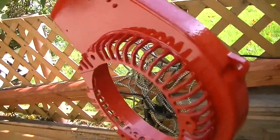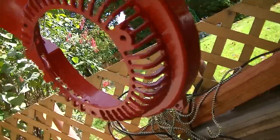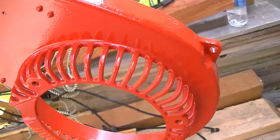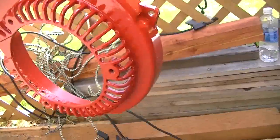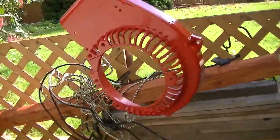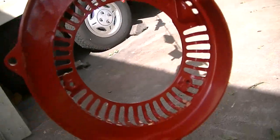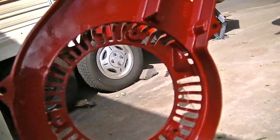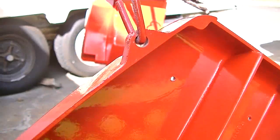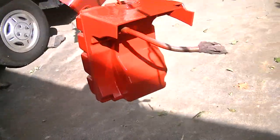The fan shroud is much the same story. Trying to get paint evenly on all of those little pieces of the grill is difficult, but I find it easier to put a light mist from the outside from either direction, and then a heavier mist from the inside. That way, if paint gets on too thick somewhere, it's going to be on the inside where it's covered up. One of my runs that the wind helped me create is right there, but it's on the inside, so I'm not so worried about that.